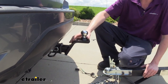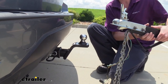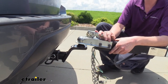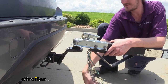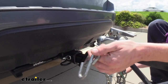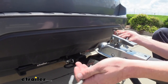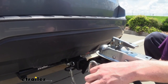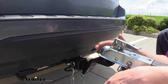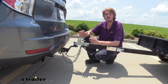When you're ready to hook up your trailer, get your ball inserted into your hitch and get that secured. Bring your trailer up — we've unhooked the coupler so it's unlatched. That'll just drop down on top; latch it into place and secure it with your pin if you have one. Then hook up your safety chains. If they're secured on each side of your trailer, you'd want to cross those — hook the driver's side to the passenger side and vice versa to create an X. That X shape creates a cradle at the front so if you have a catastrophic disconnect it holds your coupler off the pavement. Lastly, hook up your electrical connector. Now that everything's hooked up, we're ready to load up our trailer and hit the road.